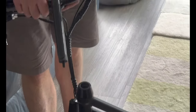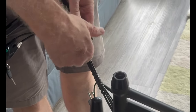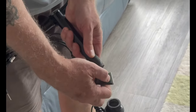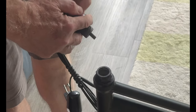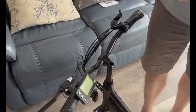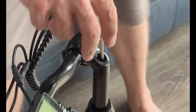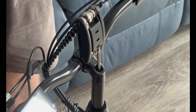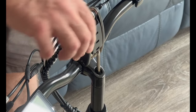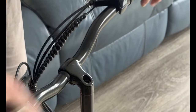Just make sure not to twist the cables - it's a little bit fiddly. You might want to loosen things off a little bit so the cables go parallel in line for the sleeve to go through. Put that sleeve through first, then slide it in place on the top. You can see the number 10, so it's a six millimeter allen key that goes in the top here. Line the handlebars up with the center of the forks, tighten by hand, then use the allen key to tighten enough to hold it in place.